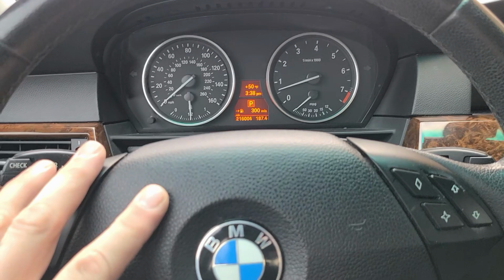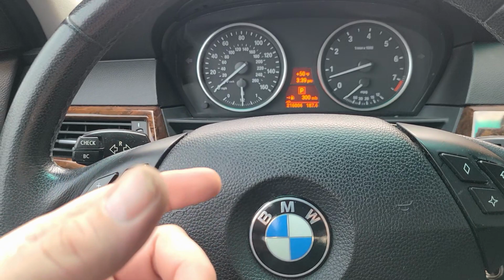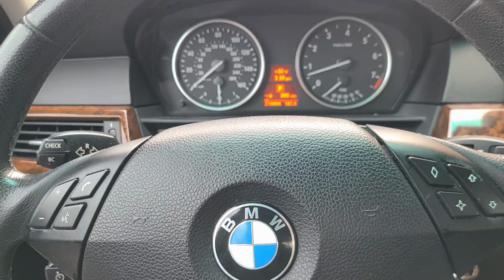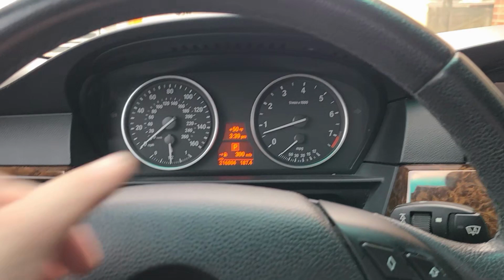Those pads, I'd never used them before, but they had a nice coated anti-rattle, anti-squeal shim on the back. And then they included those new anti-rattle clips in the front, so that was nice. So yeah, they seem like quality brakes. They were ceramic, so hopefully a little bit less dust. I don't know what was on it here. They seemed to be decent brakes before. I've never had any squeal or anything, but my light's out. It's not staring at me anymore, so that's nice. No pulsing in the pedal. Everything's good. All right.